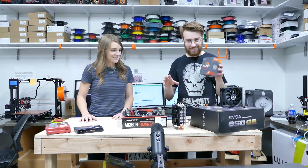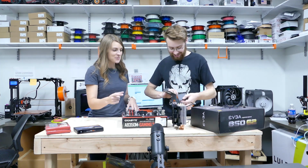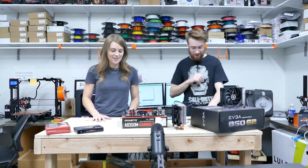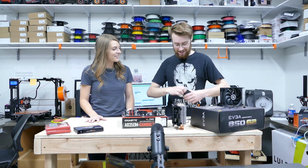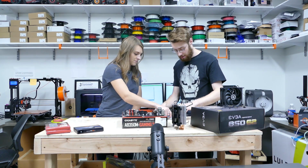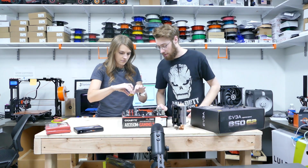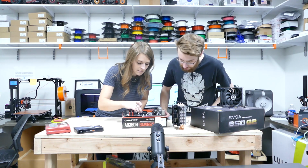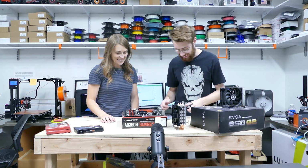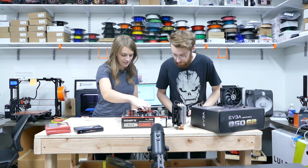Okay. And so this is where the last video went horribly wrong. I'm excited because I was trying to place a CPU in there, and after hearing it just goes right on there. Well, that one did not. So once the case is open, the pins are really easy to bend. So always handle it by the edge, line up the triangles, and then it should just fit right in. Oh wow. Just like that. We're good now. Okay. So then just push the lever down, and that's going to lock the CPU into the socket.